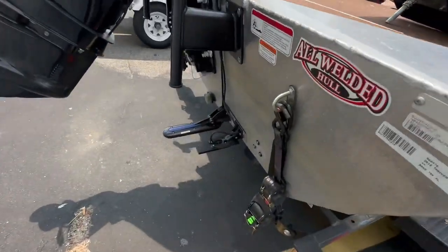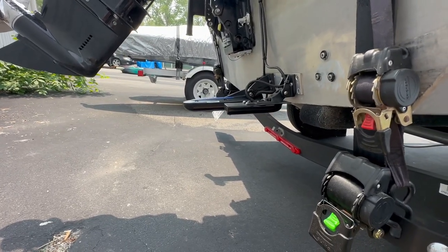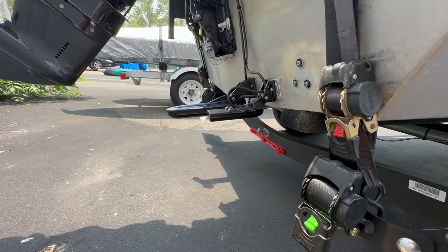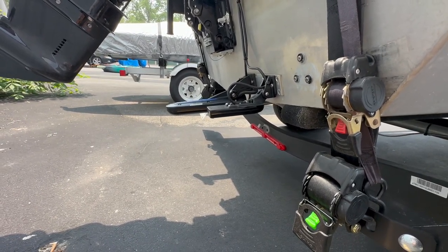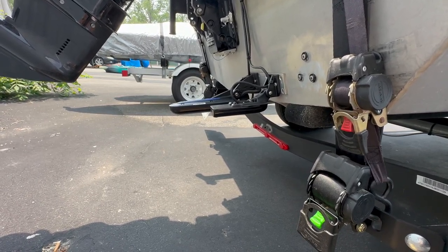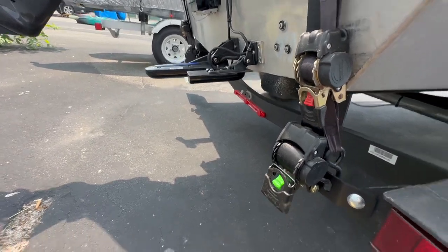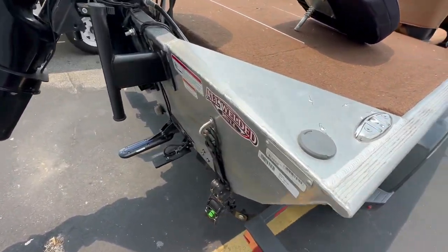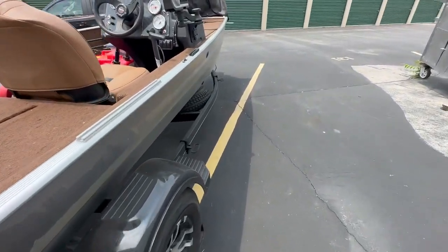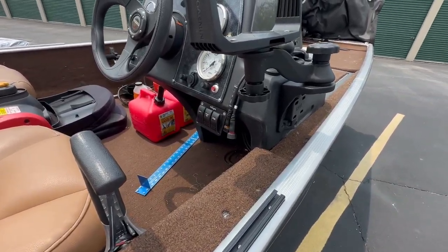So with the transducer, you want to make sure they're connected properly. I think they stop working, as far as reading depth, both of them the same way, after maybe 33, 34 miles per hour. But if you're cruising along, going 30 miles per hour, it can still read depth the whole entire way. So if they're connected correctly, they're pretty good. You want to make sure you get one with GPS.